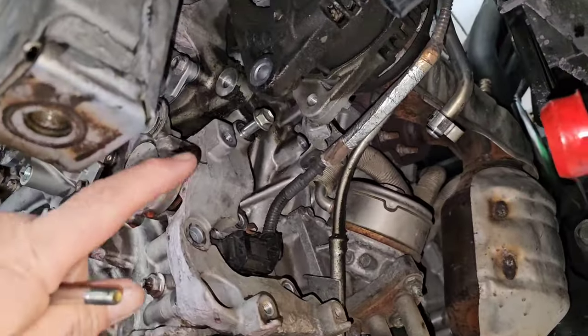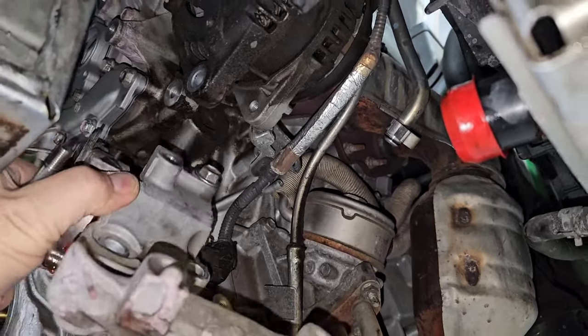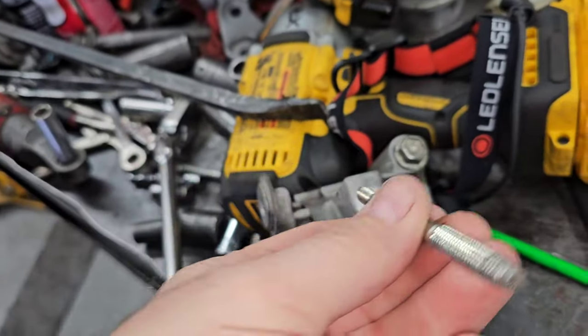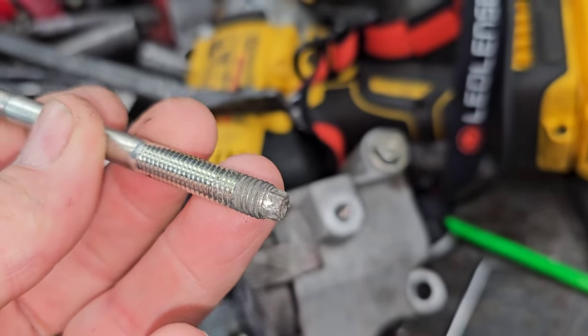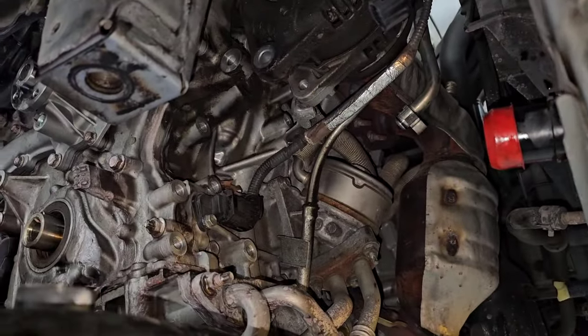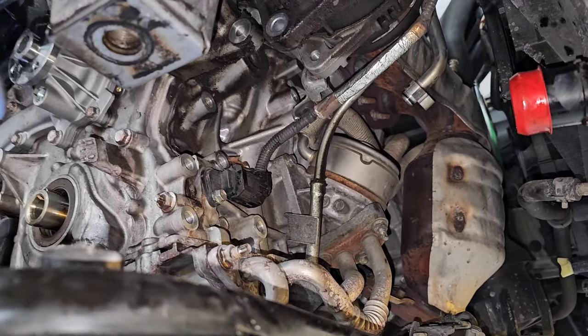I wound up pulling the compressor out. I had to pull the lower bolt out of the alternator and slide it forward so I could get all the bolts out for the tensioner. Now one of the studs here — this is for the AC compressor — went into the block, so you need an inverted Torx to get this out, which is a little bit of a pain in the neck. I could have probably worked with the compressor in the way, but instead I just hooked the AC machine up to it and sucked the whole system down so I could take the compressor right out. Pretty much that's it — reverse procedure to install.